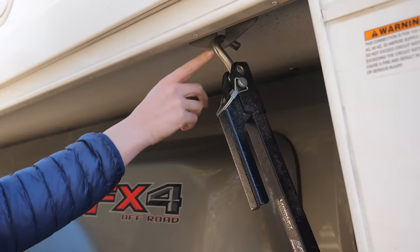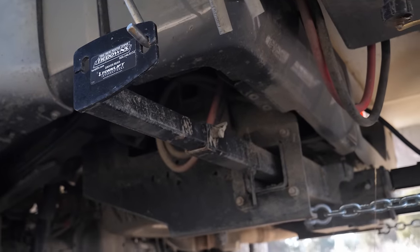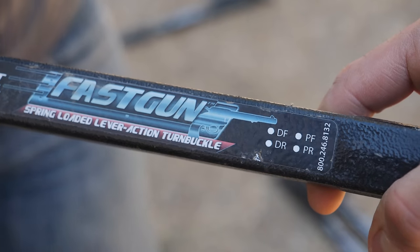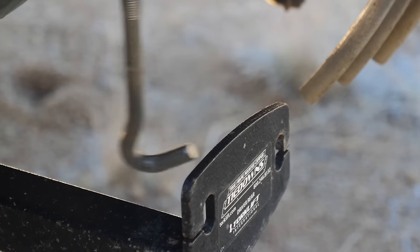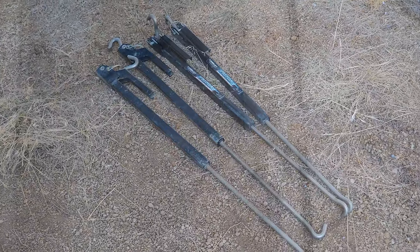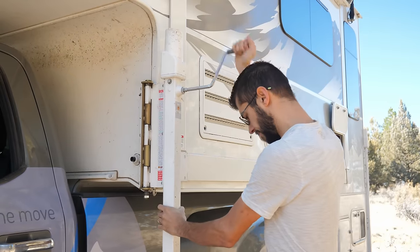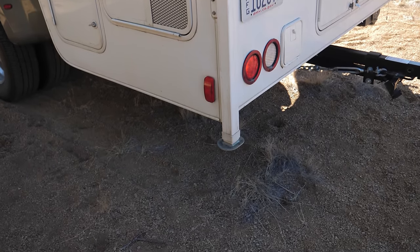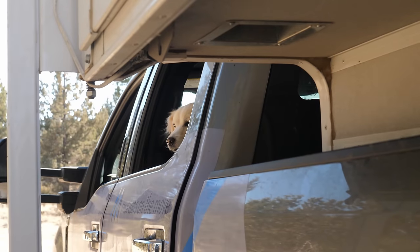The mounting bracket is typically on the underside of the truck camper, and the truck will have mounting brackets that stick out from the sides and/or the hitch on the back. The tie-downs themselves come in many different forms including chains, turnbuckles, and what we're using on this camper called the fast gun. These are spring-loaded turnbuckles that after removing the safety pin pop up and can be easily removed. Be careful when removing them so they don't swing into the truck and dent or scratch it. Truck camper jacks come in a variety of types, primarily electric or manual. On dually trucks the jacks need to be swung out so that the truck will be able to drive out from underneath the RV.